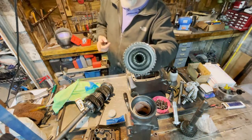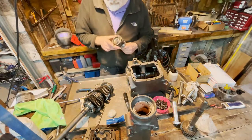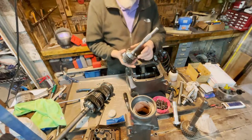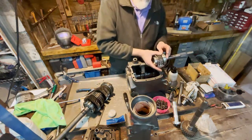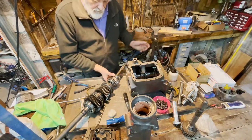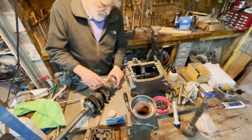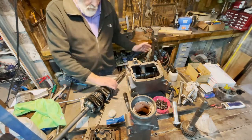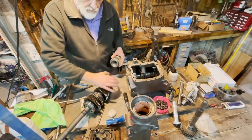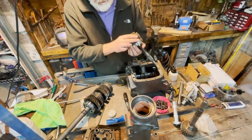There you go, plenty of grease. So we will not assemble this on the table and then put it in there, because mounting the bearing as a last action would mean that we are hammering the bearing on the axle and squeezing all the synchronizing rings together. The force of the hammering in the bearing will be taken up by the synchronizing rings. And that's a procedure I don't really like. So I prefer to do it this way.